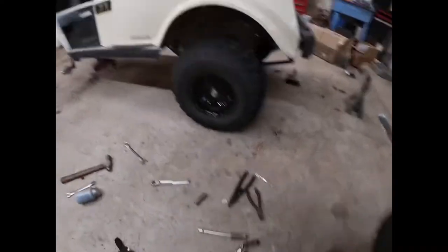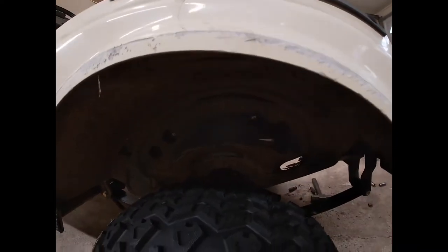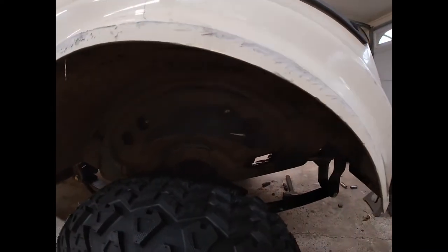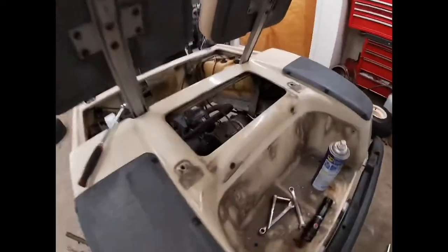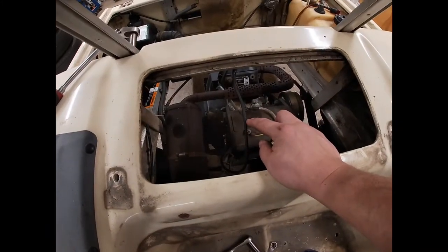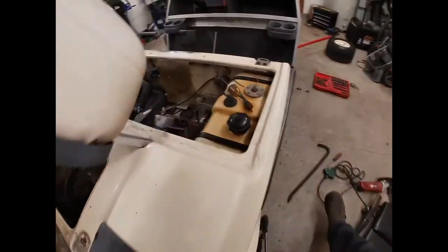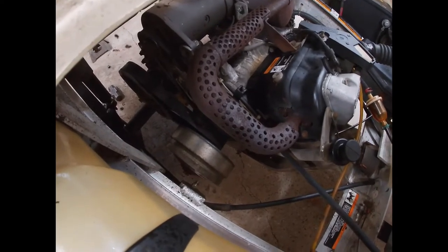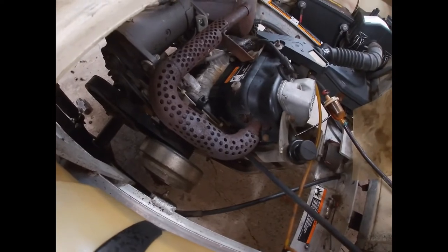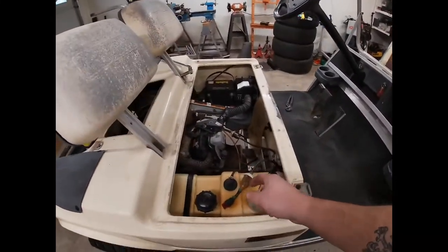The bushings in the leaf springs were so bad the tires were swaying back and forth and rubbing. It came from a golf course, so they probably weren't high on PM — just get it out so they can play another round. I also noticed this ground wire was way too short, so I made a new one. I changed both belts, and make sure you change the back one before you put the front one on — if not you have to take it all back apart. I missed that on the first one and had to tear it back apart. If you take that front pulley off, the bolt is left-hand thread — another thing to watch out for.